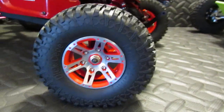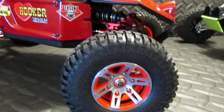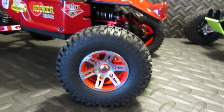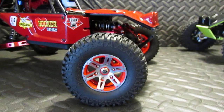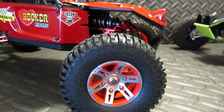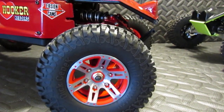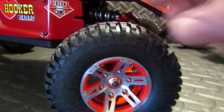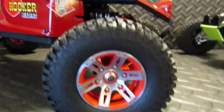Take it and put the whole thing in the freezer. And lift a little corner of the tire up so that air can get inside the tire and under the ring on the inside, because what you're going to do is decrease the temperature of the air inside that tire to your freezer temperature. Leave it in there for about 30 minutes. And that more dense air in the freezer will eventually fill the pocket of air inside this tire. Once you've done that, and it's set there for 30 minutes, go and quickly fold the bead down onto the inner ring and put on your outer wheel and start squeezing it down and putting your screws in.